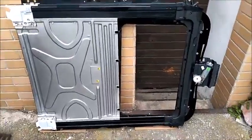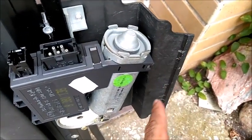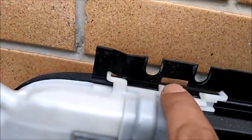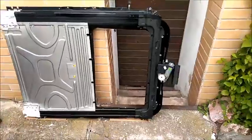Okay, I have the cassette out. It's a big job. Careful with this lip. It has a notch here and here. Try to pry it with a flat screwdriver to get it out while somebody is holding the back and supporting it. You have two clips here going through this part. You have to unclip those plastic ones first. Unclip it. This is how the car looks now.